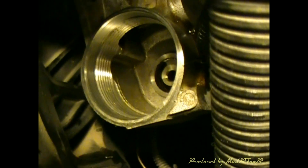Get a little bit of oil on my finger and lubricate that other O-ring. I also made sure it was clean above the threads where the O-ring seals. So you just take your filter assembly after you've lubed up that O-ring and drop it down inside. When it screws in, make sure you don't cross-thread it — it should go in nice and easy for most of the way until you get to the O-ring part.